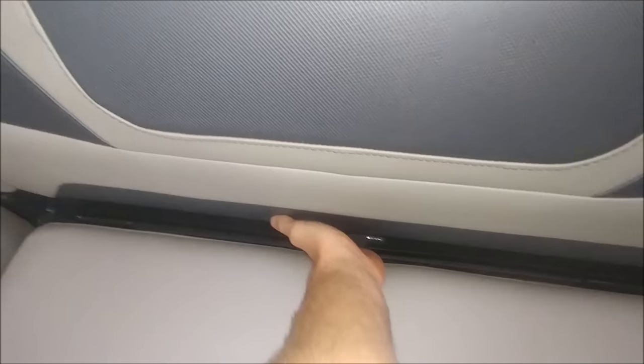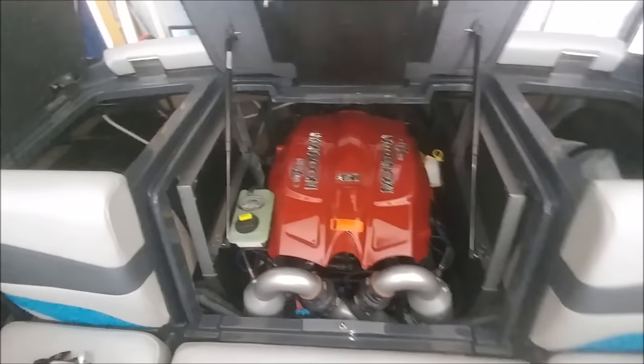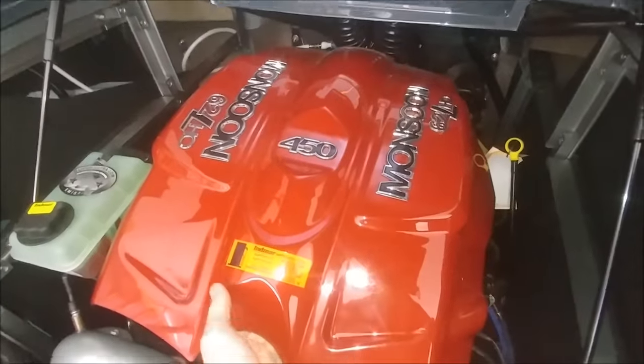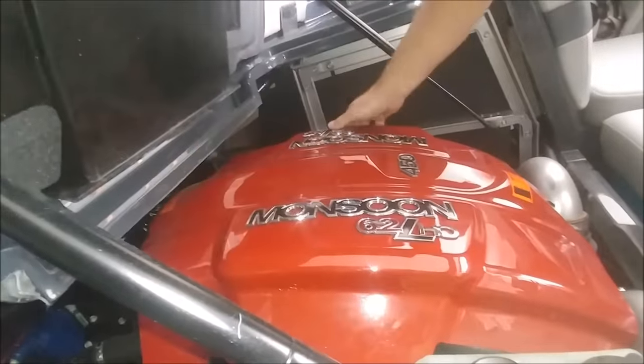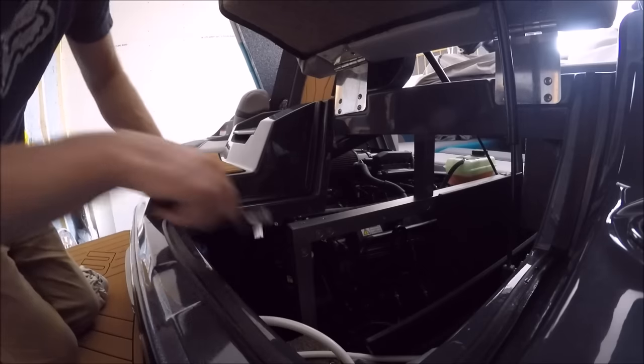Next I'm going into my engine compartment. On the 24 MXZ, you have to have both top hatches open and then your right and left locks open, and then you open the whole compartment. You're going to want to remove the molding or pretty piece off the top of the motor — it just pops right off. Then I'm showing you where the oil cap is and where you'll be putting the oil in. I'm pulling the dipstick up just to release any suction, and same with the oil cap, so it can flow without any suction from up top.